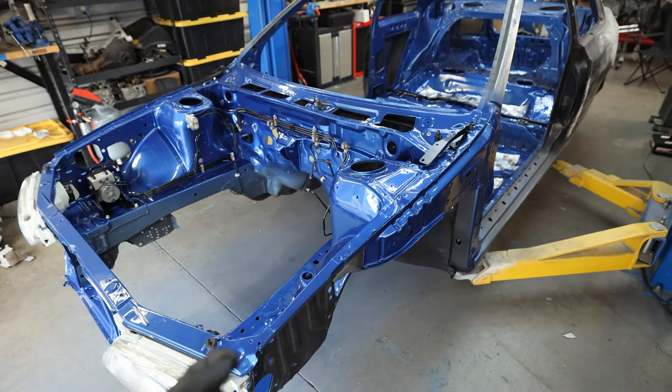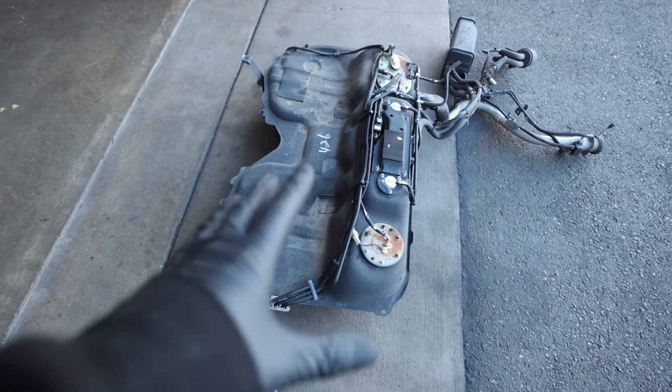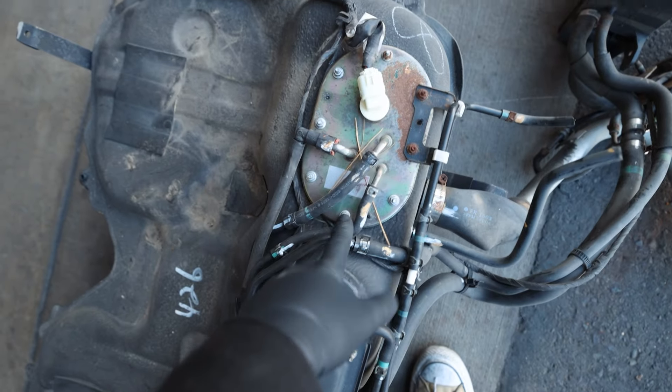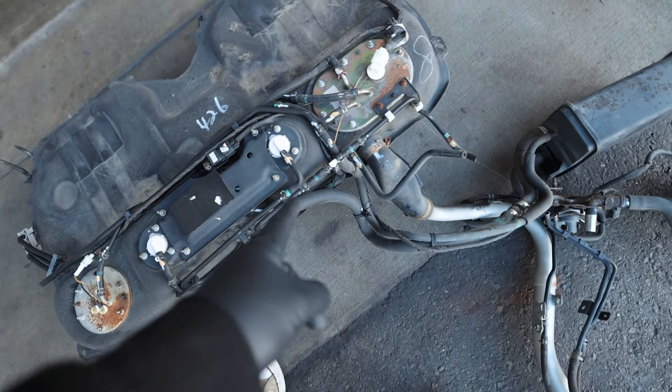With our sound deadening pretty much wrapped up, I want to jump over to the fuel tank. There's still a little bit of fuel left in that, so we need to get the fuel out, get all the fuel lines off of it that we're not using, clean it up, respray with some new undercoating, and let that thing sit for a couple of days. We can't even install it until we get our hardware in because I won't be able to get to these brake lines up here to put the valve in that connects them all together without covering it with the fuel tank. So right here, we have our 2005 STI fuel tank — this is what's going in. It should be a drop-in fitment. Before we get this in, I do want to remove everything we're not going to be using, such as the three hard lines coming off of the stock fuel tank, because we are going to be using a radium hanger — just feed and return off of our new hanger.